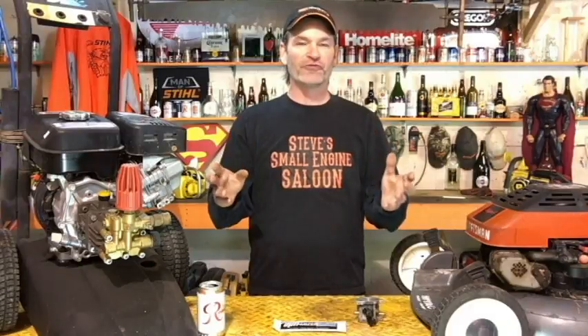Step four: now that all the fuel is out of the tank itself, you still have some fuel left in the fuel line and inside the carburetor — it's still holding about an ounce of gas. Take it outside and restart it. Let it run until it dies. That's all you can do with a four-cycle, four-stroke engine. When it dies, it is out of fuel — the carburetor, the fuel tank, and the fuel line should theoretically be dry. But the inside of the carburetor is still coated with that stabilizer, and that's what you want. Theoretically, six months later, you put fresh fuel in and it should start up and run just like it did the season before.